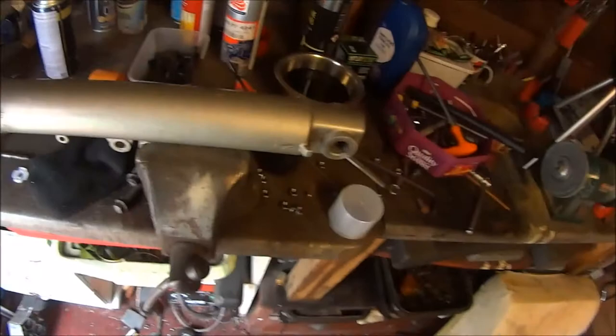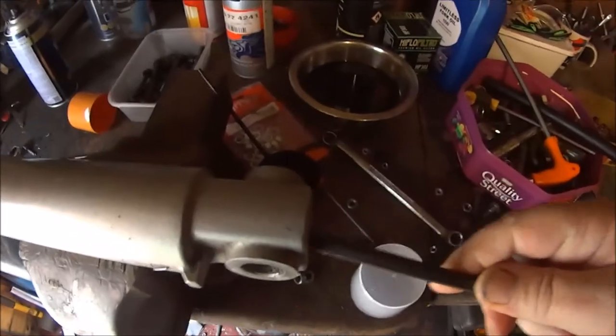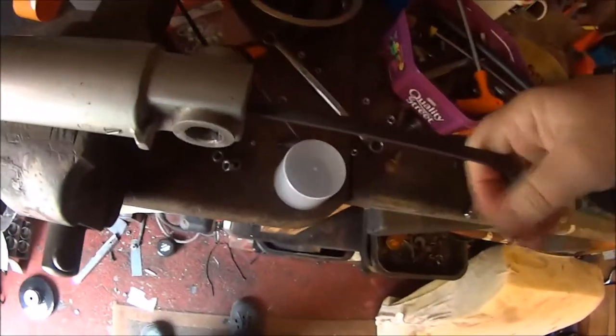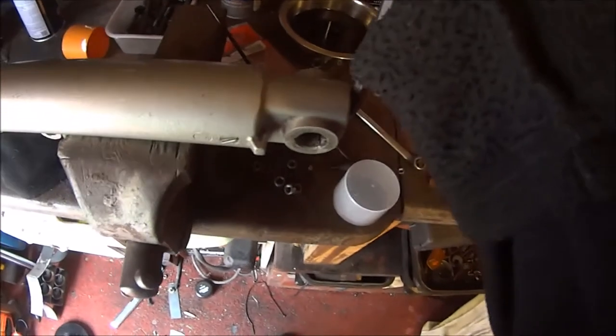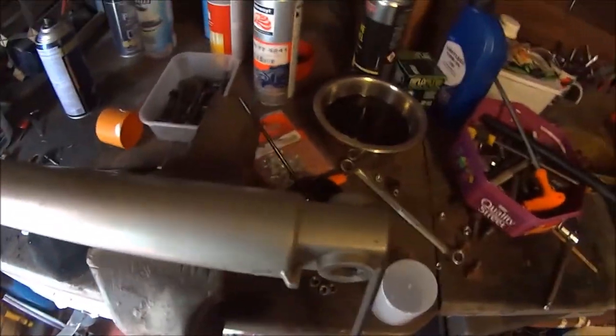Time to refurbish the forks. This one I've slackened the big nut and cleaned it up a little bit. In here there's a damper rod and you stick your allen key up with it and undo it — which is like that. So often happens on forks: when you turn the bolt you think it's undoing but it's not, it's just the damper turning by itself.